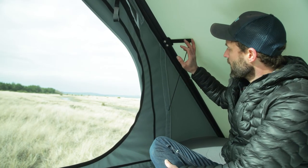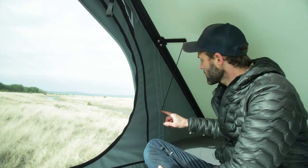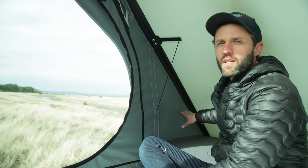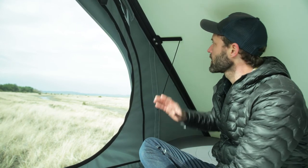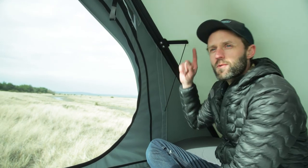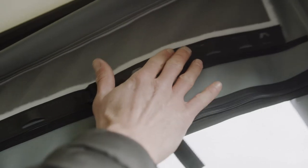We designed this retractor bracket to put some elastic tension to the center point of the sidewall of the tent on the hinge side so that as you close it, all the material up towards the hinge is going to organize itself and pleat inwards. We mounted the bracket into a T-slot that runs around the entire perimeter of the interior of the tent so that you can use it to mount any accessories you might want on the interior of your tent.